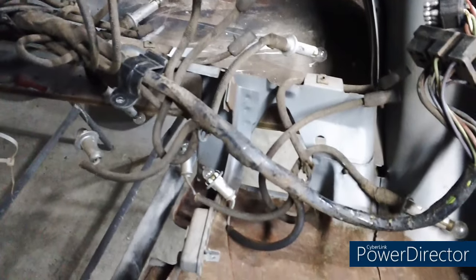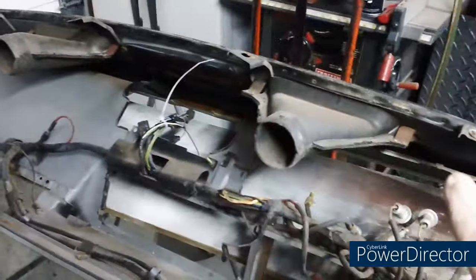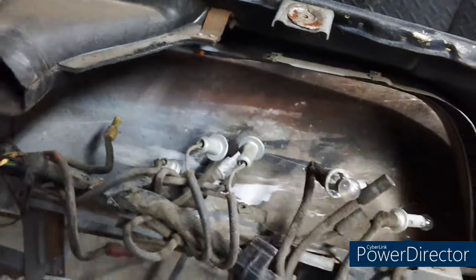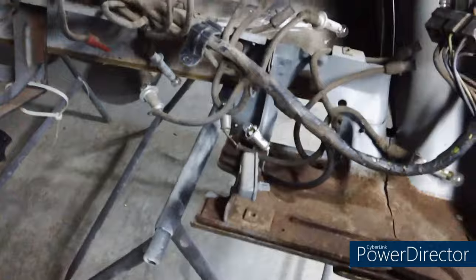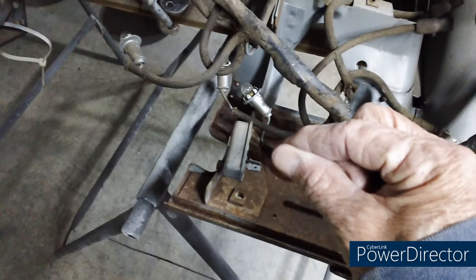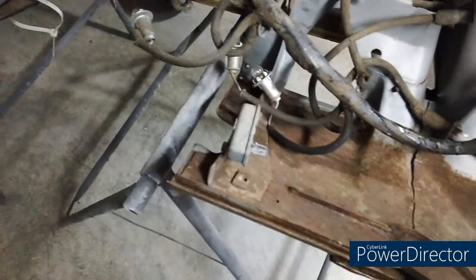Before we rip out the heater core and that big black plastic box, I wanted to point something out brought up by one of our good subscribers. We're on the back of the dash now. I had previously said in another video that I thought this was the CVR - the constant voltage relay - and I liked where it was located because most of them are located on the back of the instrument cluster. He wrote and said no, this is probably the delay relay for the seatbelt light. So when you start your car, on the overhead console there's a red light that says seatbelts - this thing's contacts will close giving you that light, and after they heat up after about 10 to 15 seconds, it'll pop open and the light goes out. That's what this is right here.